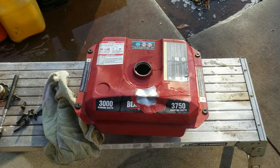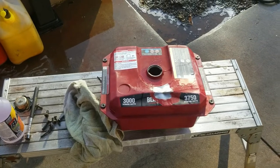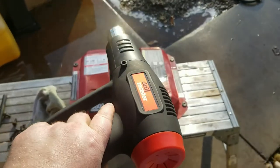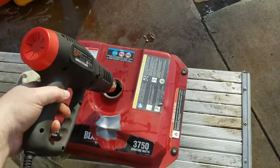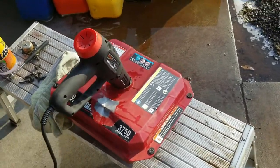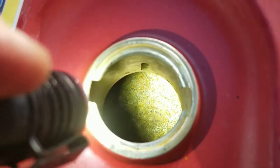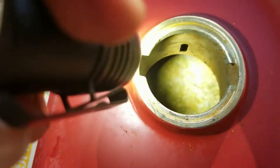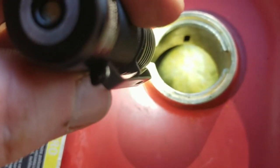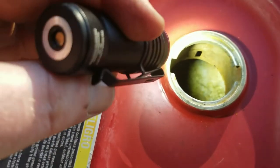Now that I've got all the water out of the tank, I don't want to wait two or three days for it to air dry. You can take a hair dryer or a cheap heat gun — you can pick one up at Harbor Freight for about ten bucks — just set it on the first heat setting and leave it in there for a couple minutes, watching it so it doesn't get too hot. I got the tank all dried out with the heat gun, and you can clearly see there's just a little bit of flash rust from where the tank was wet and I dried it out. But you can tell there's no heavy rust — it's mostly white-silverish metal in there with just a hint of orange, which is typical.